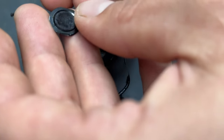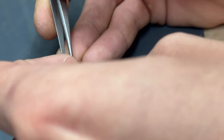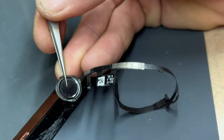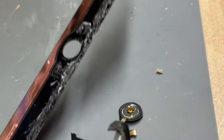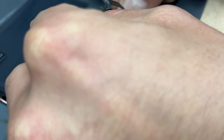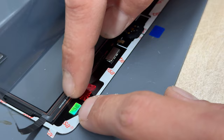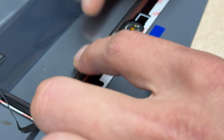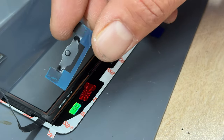Because the adhesive has come off the gasket, and the new display has one of those gaskets on it already, I'm going to remove the old one. To do that, get in between the rubber and the plastic and then just peel it away with the tweezers. That's now released and ready to install onto our new digitizer. Work the home button straight into place — you can see the plastic gasket is there on that one. Make sure it is seated correctly, because if it's not, the button will not sit right and it'll end up sinking. Place the button down and apply some pressure to the flex cable using the old adhesive.